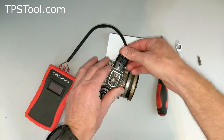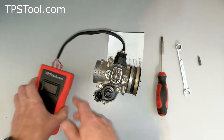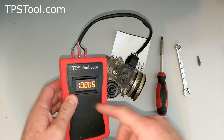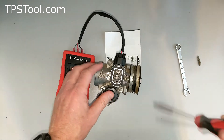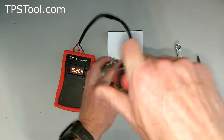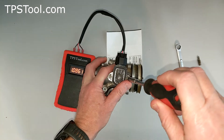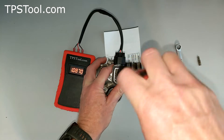I'm going to plug that in here — if I put it the right way it helps, there we go. Remember we're looking for 1.12 ideally; we're at 1.08, so this one's a little low. To adjust it, all you need to do is take a screwdriver, loosen these two screws, and rotate the throttle position sensor to set the voltage.